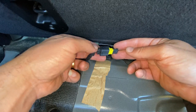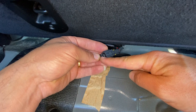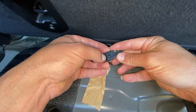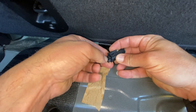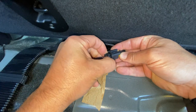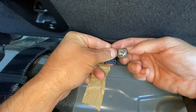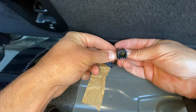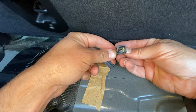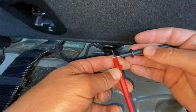To disconnect this plug, if you just turn it over you can see a clip on the side. There's a little barb clip there - you just push this little bit down and once you push that down you can slide the left hand side out. Just pop that little clip in, get it moving, and away it comes. In here we can see straight away, just as we had on the front, the two pins for the seat belt connector - that's what we're going to get our multimeter on.